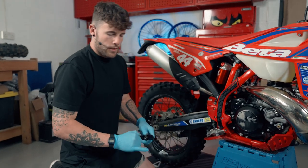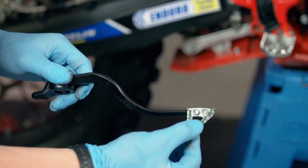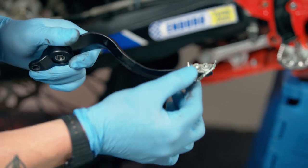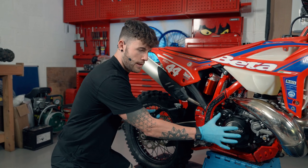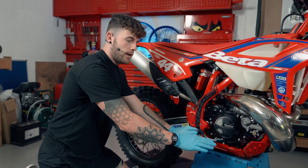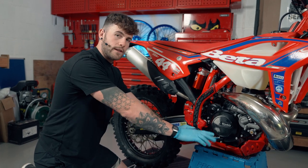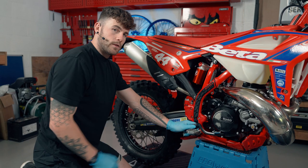Another little tip: the end piece here is called the brake tip. As you can see we've got two bolts which are removable. You can actually buy replacement tips that are stronger or extended pieces so they're bigger. A lot of people that run engine covers find it steps out on the bike a little bit, making it quite hard to reach the brake tip with the boot. So an extended piece gives you more room to get your foot in.